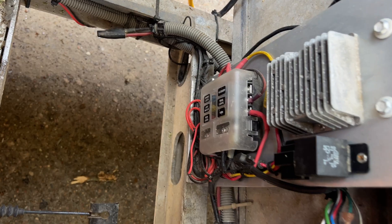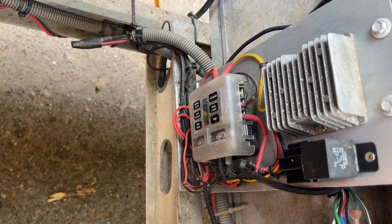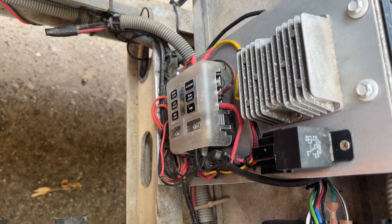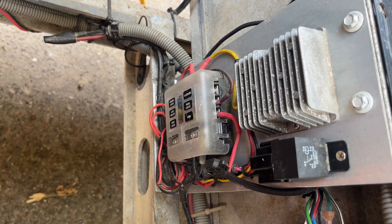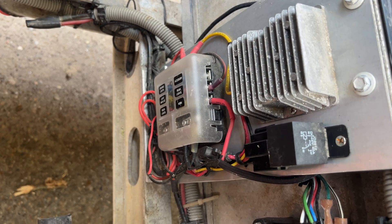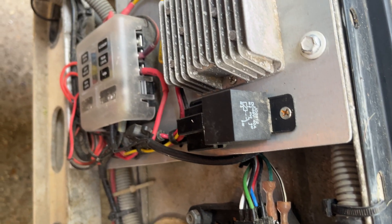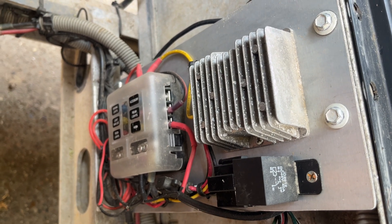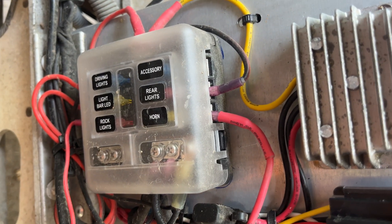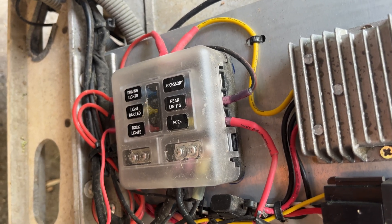I think I had another question about my 12-volt converter. It seems a lot of people are converting their carts and there's always a question of how to get power to it. What I've done — and I addressed this in a previous video — is I relayed my switch to the cold side of the switch on the dash. When you turn the switch on, it activates that relay, which turns on the converter and sends power to that 12-volt fuse block. That's what powers all of my accessories.